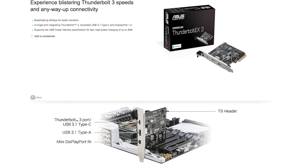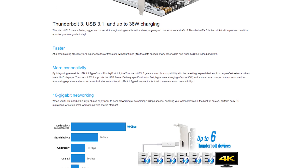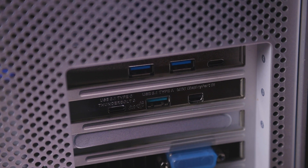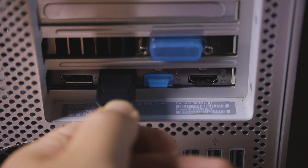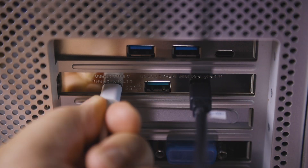That's where everything stood for me for the last month. Then recently in the Facebook group 'Mac Pro Upgrades,' someone found a solution: a PCI card called the Asus Thunderbolt EX PCI card. What's really interesting about this card is it doesn't take the video signal from a Thunderbolt header — it actually takes it from your video card. This sidesteps the whole Thunderbolt process. You take your video signal from your video card into a mini DisplayPort input on this card, and then it connects out to your Thunderbolt display.